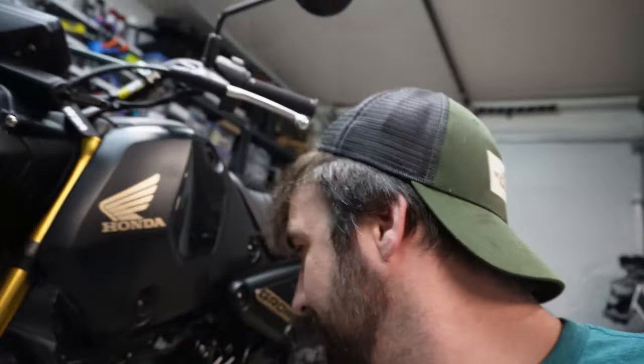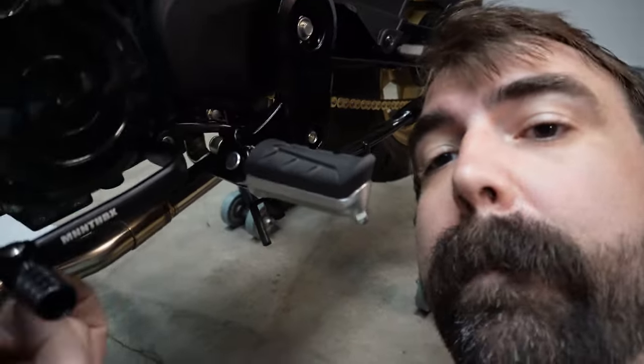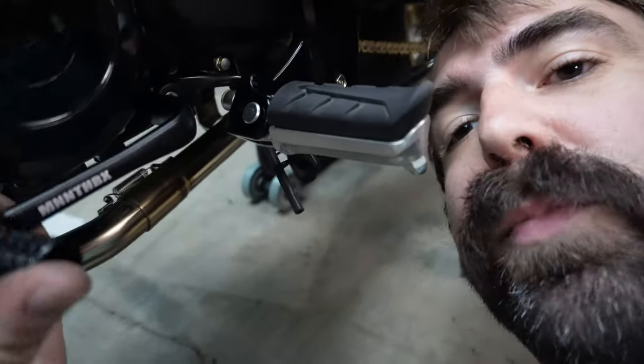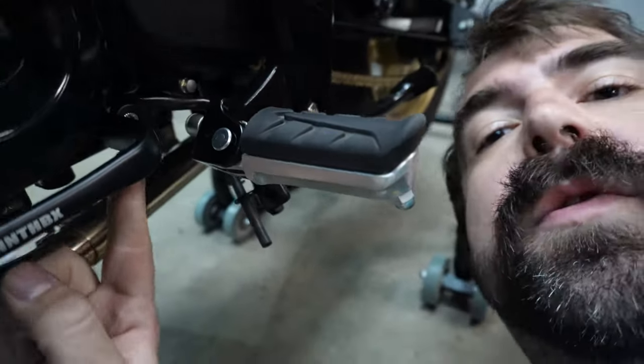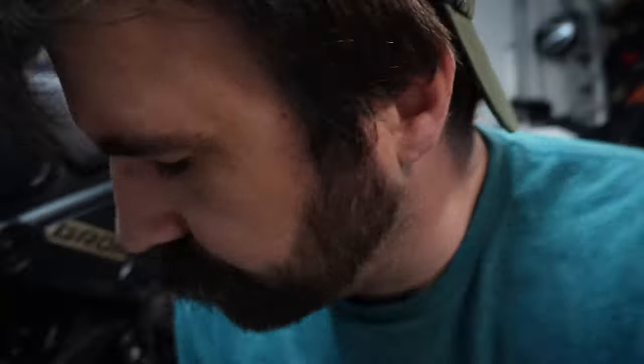Yay. We're done. Yay. Oh yeah, I'm going to get on the ground for this, I guess. The man-in-the-box shifter right here has a nice little spring tip, and goes directly on the shift shaft, instead of the stock one that has those little, I think they're rose joints in there. That just leads to a little bit of slop. So that was a really easy and cheap add-on to do while we were in there.